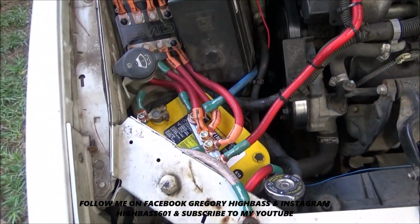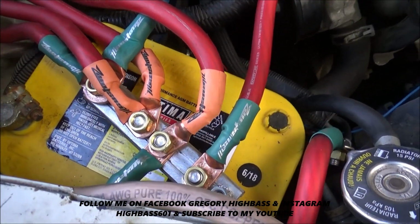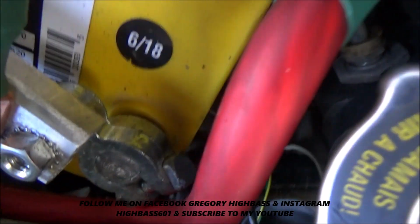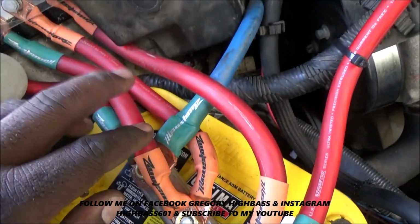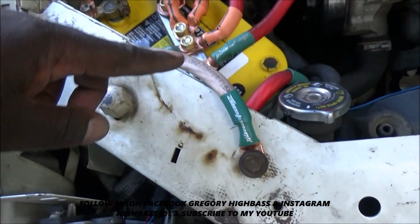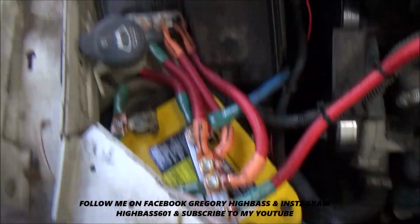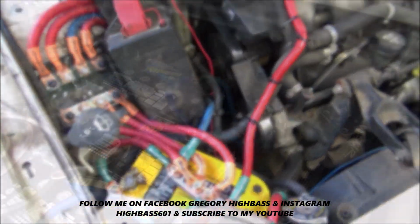All right, guys, we are Gucci. All right, so like I said, I removed the battery plate and it dropped down a couple inches just like I needed it to. And I got clearance up under here. Plus I got the wire in front of the terminal just in case the battery slides, but the battery ain't gonna slide because these wires right here are tight. So I ran him a frame ground here, and this is the other ground that's coming from there. I know y'all probably wondering, is the hood gonna hit it, but I already checked it, it's clearing it. Plus I didn't want to alter another hole, so this was a good ground, so I want to use that right there. We're done. We're moving on to the back now.